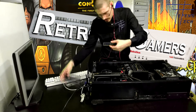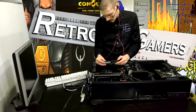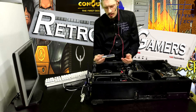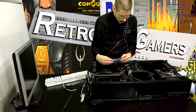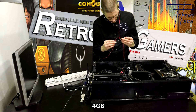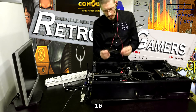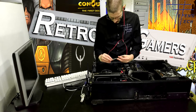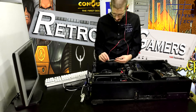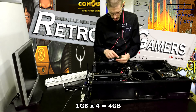Let's take a look. That's the front side and there's the other side — probably the front and probably the back. You might say, well, I've seen RAM with memory chips on both sides before. What makes this special? This is a four gigabyte stick and it has one, two, three, four, five, six, seven, eight — 16 memory chips total. Here's how these work: 256 times four equals one gigabyte, two gigs, three gigs, four.